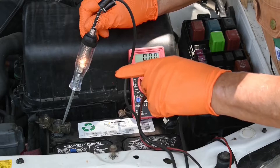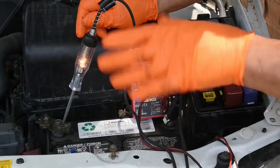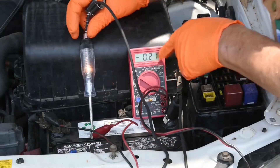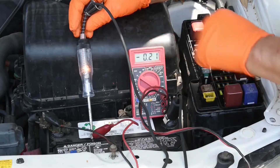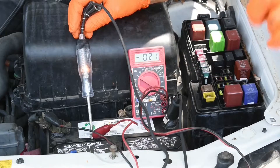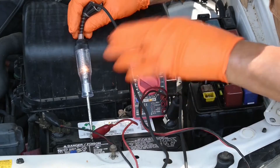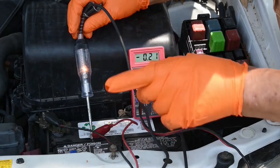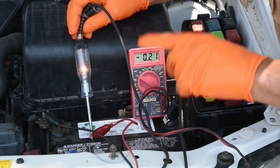This is not a whole bunch of electricity, but if I left this light for about a week, yes, the battery would go down — especially a weak battery. I measured it: the test light uses approximately a quarter amp, about 0.21, rounded to 0.25. A quarter amp is a very small amount. A lot of vehicles have this drain, but when you use it every day you'll never notice it. This vehicle has a problem drawing about a quarter amp.